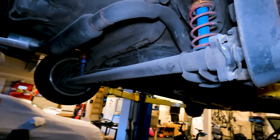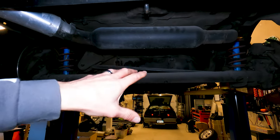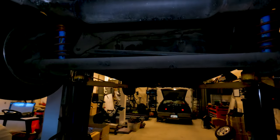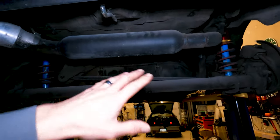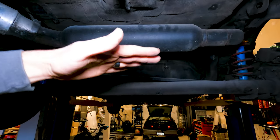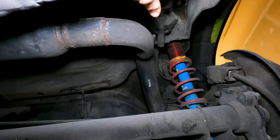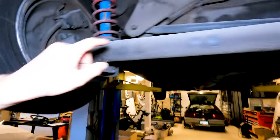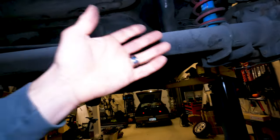In the back, we don't see any sway bar at all — just this axle. Because it's an axle, you start to wonder if there's even value in putting a sway bar back here. What we do find under high cornering loads is that as you put too much load on one side — say a left-hand turn loading the right side — the inside wheel is going to want to pick up, and you lose a little grip in the back. In high-performance applications, people put sway bars on here to keep the rear axle as stable and level as possible through cornering. They utilize a bracket mount with a long link and U-bolt clamps onto the axle to add a sway bar — you can actually see there was a sway bar on here at one point, with U-bolt clamp marks on the axle.